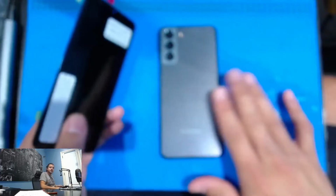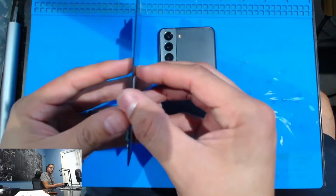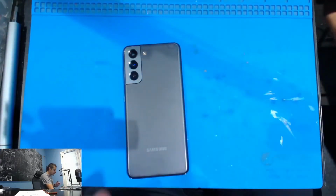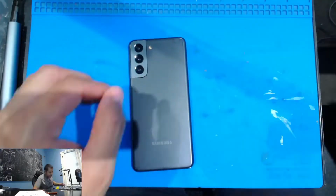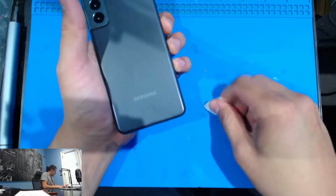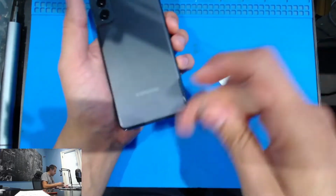Alright guys, so this is going to be a screen only without the frame repair. Here's the screen, how thin it is. And the back is not glass, so when you heat it up you have to be a little careful not to overheat it because it will start wrinkling up and bulging up. You're going to get your special pick that we have in our toolkit found in the description below. For this, since it's not glass, you can use whatever, just be careful, but we have our special pick for the glass so you don't break it.